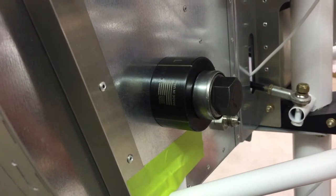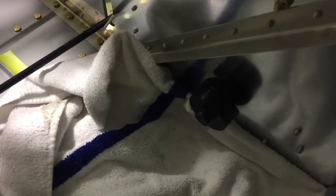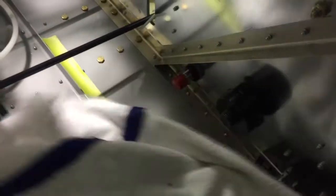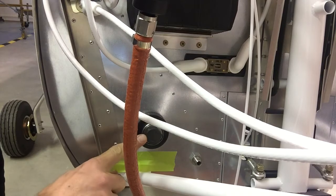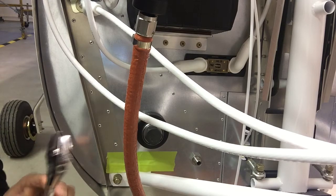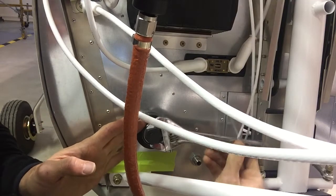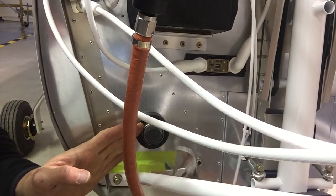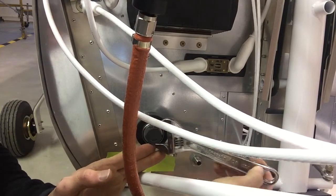All right guys, check this out. I have it sitting in place here just ready to go. This is on the outside of the firewall — it doesn't really matter which way you do it, but this is the female part of the punch. On the inside, that's the actual punch part just sitting here. Now as I tighten this bolt, it's just going to drive this through the firewall and punch a hole. I actually don't even need this towel in here anymore because there's no metal chips or anything that it creates. It's ready to go — I just have to tighten this bolt. This is easy to do with a ratchet and a socket, but I don't have a socket big enough so I'm going to use the trusty crescent wrench, trying not to scratch anything like the engine mount. All I do is keep turning this, and as I tighten it, it's pulling the punch through the firewall and into the female part.